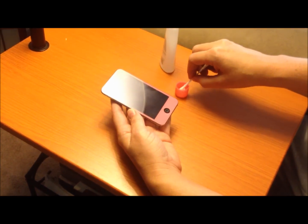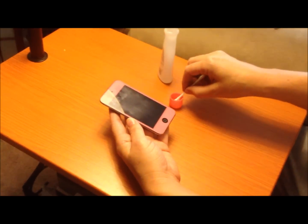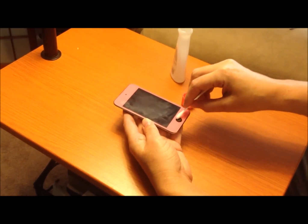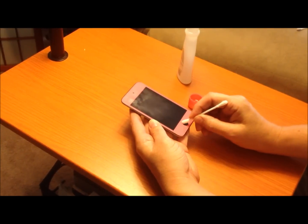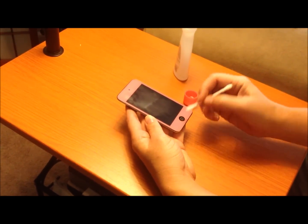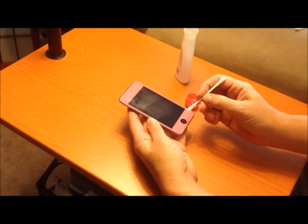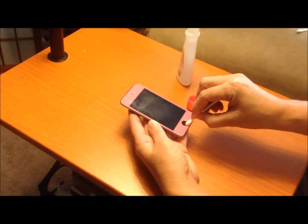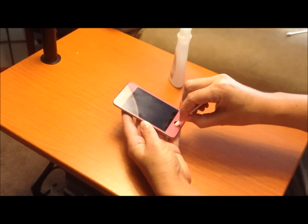This is my daughter's iPod and the home button began to be unresponsive. So we're going to take some of the acetone and I'm just going to put a nice big drop right there on it, hold it at a slight angle, put a little bit more. It takes a second to start getting behind that button — the acetone dissolves the oils, lotions, dust, debris, whatever it is. So I'm going to start just slowly rolling around the edge of the home button like this.